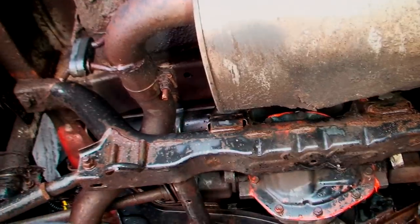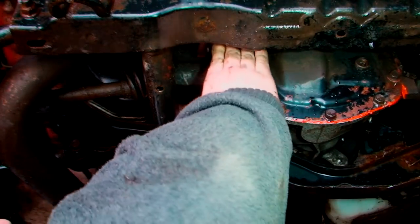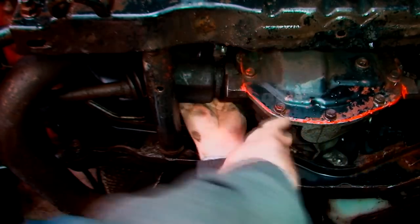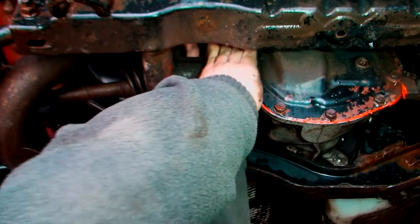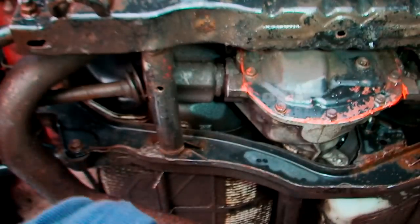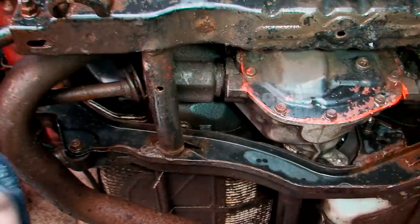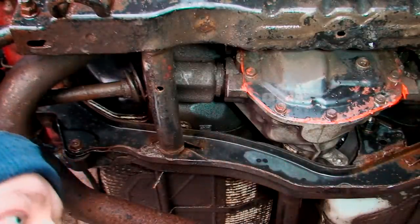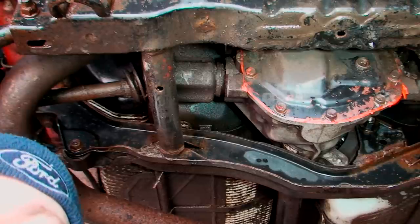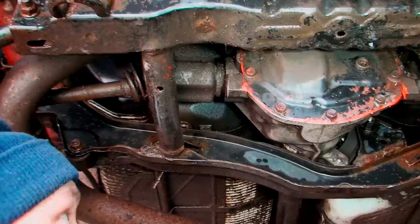Hopefully everything is off now. This is where it becomes difficult — do I have room to take off any of these things? I'm just trying to move them out of the way because I think with a bit of wiggling I can get the front one out. The thing is, if we take the whole crossmember off — this big bar and this big bar — it's all connected to the suspension, so you'd have to track it. That's a big job because a lot of parts depend on it being completely level. If you don't have a tracking machine and you're trying to do this at home, it's going to be a nightmare.